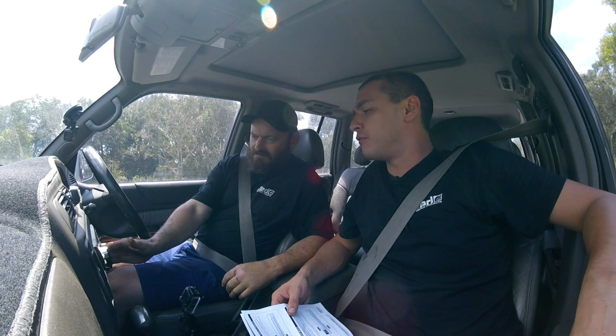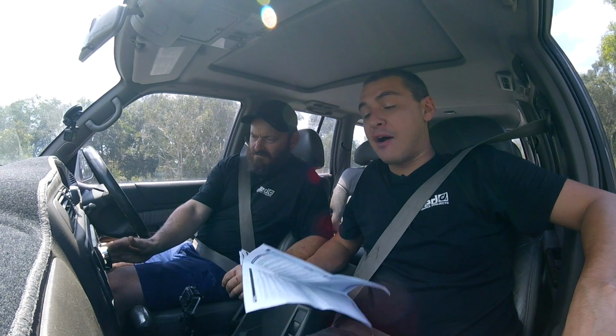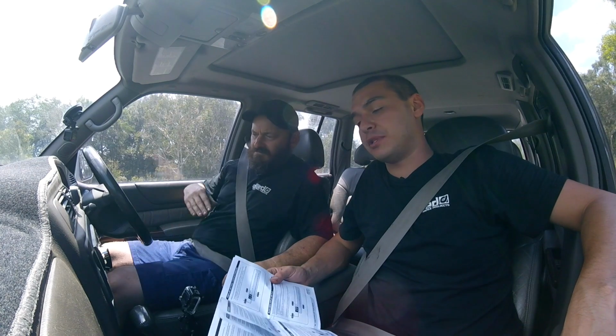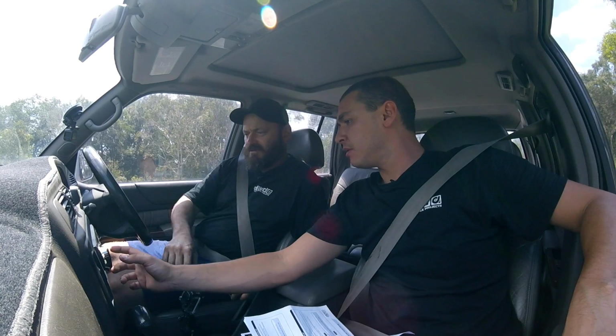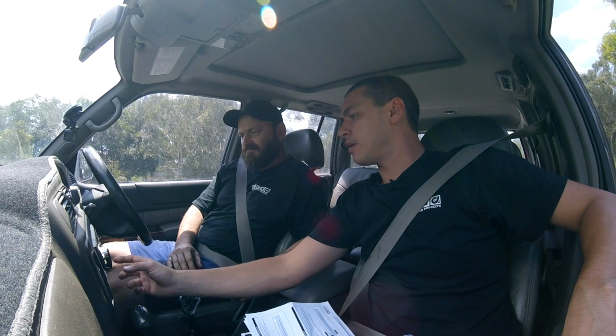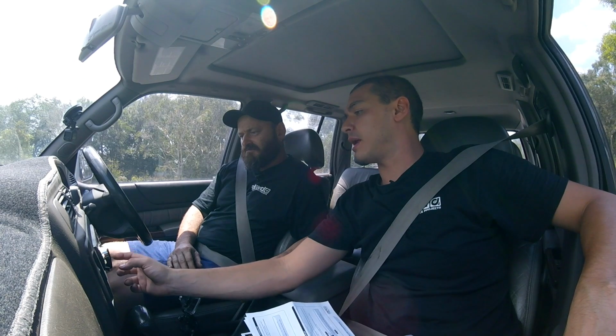We've just filled up with fuel and given a little hit out of the fuel station, and we're only getting 14.5 PSI boost. After reading the instructions, realised you have to set the overboost setting first. So Alan set the magic number to 30. Yep. Now we can go through into our duty and set our boost pressure from there.